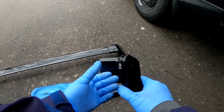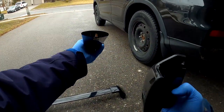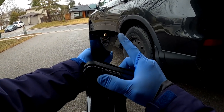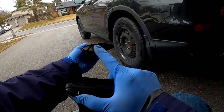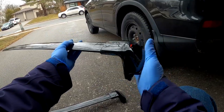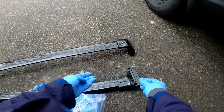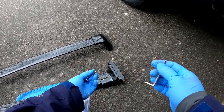Be aware there's a right and left side. The bars are shaped kind of like an air wing — aerodynamically. The front leading edge is a bit bigger and the back is a little smaller, like a wing. Face the larger edge to the front. Don't put it on tight right away because there's some adjustability — tighten everything up after you've installed them on the car.